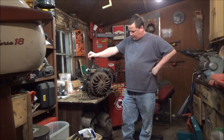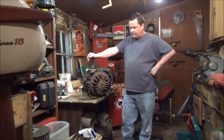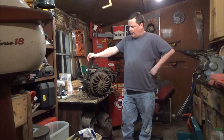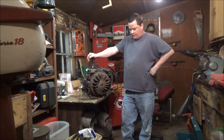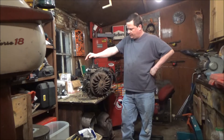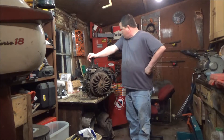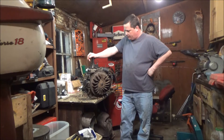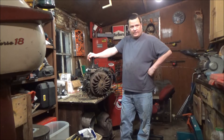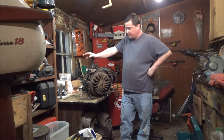Welcome to the garage. This is a Kohler KT17, 17 horsepower cast iron twin off of an '85 Wheel Horse 417 8-speed. I hadn't planned on rebuilding it — I thought it just needed a valve job. It's burning a lot of oil, so I figured valve seals or guides. But with 1800 hours on it, and the amount of carbon and crud inside, I don't think it's ever been rebuilt. So I'm going to rebuild the whole thing.